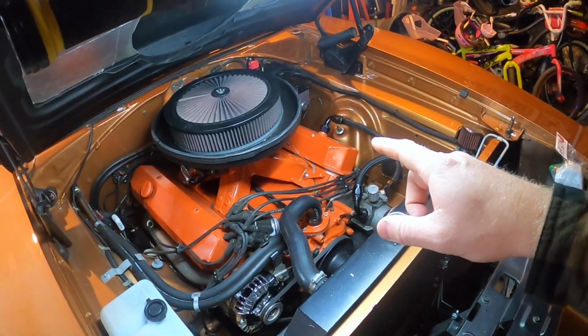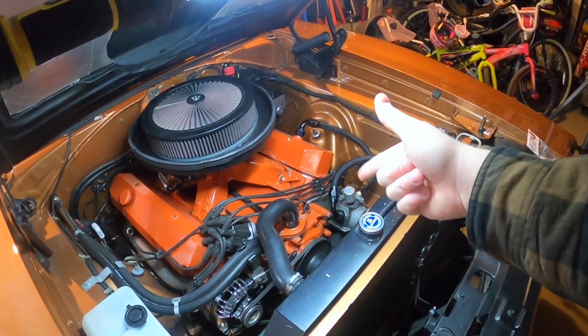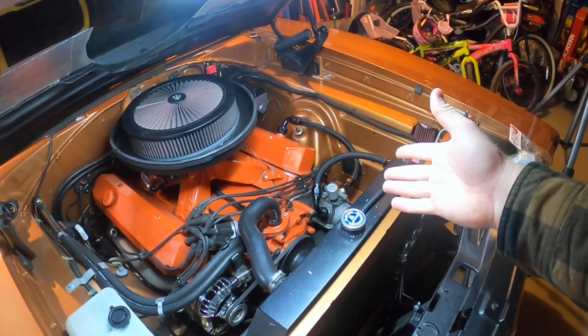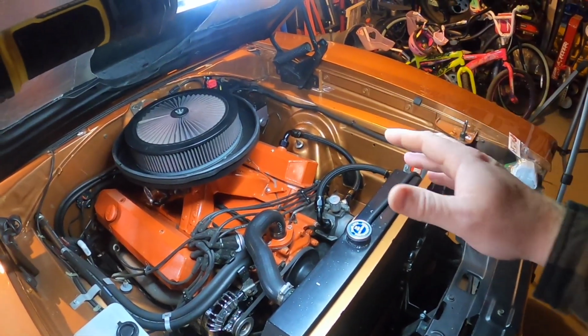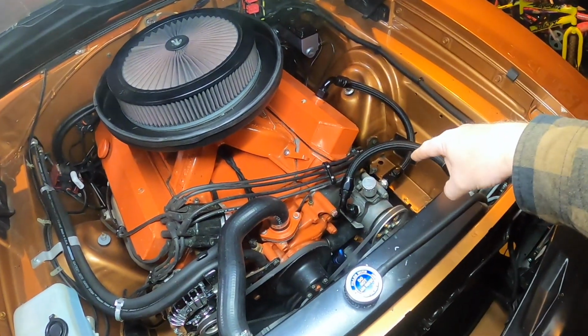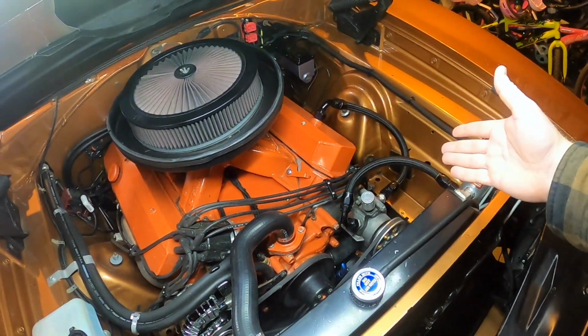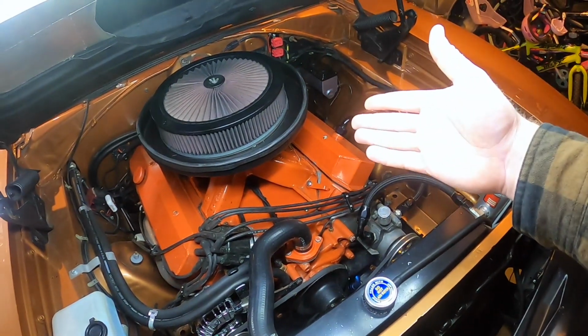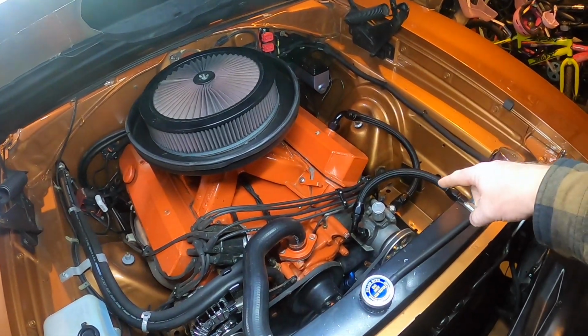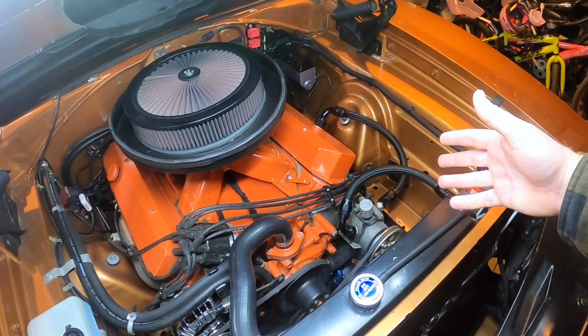And what am I going to do with that motor? The plan with that 505 was to replace the 535 that's in the Charger now. There's nothing really wrong with the 535, but there's a couple things I'm not terribly happy with. First, I definitely wanted to get rid of the JZ Motorsports vacuum pump. I shouldn't be running a vacuum pump on the street unless I'm running a big boost application. That's super overkill, and quite frankly, it's not getting the oiling that it really desires.